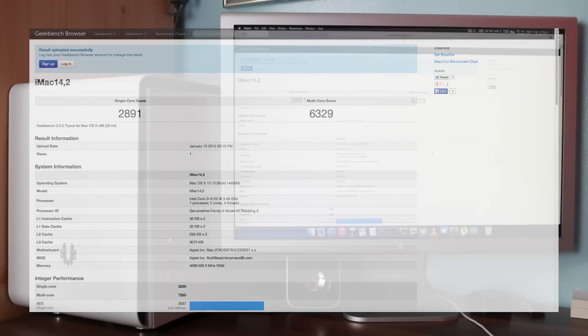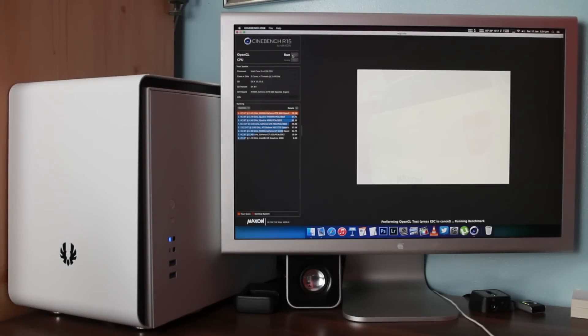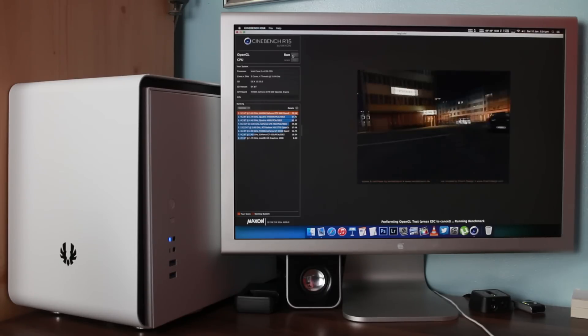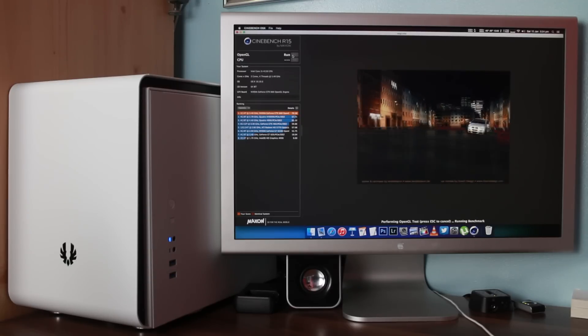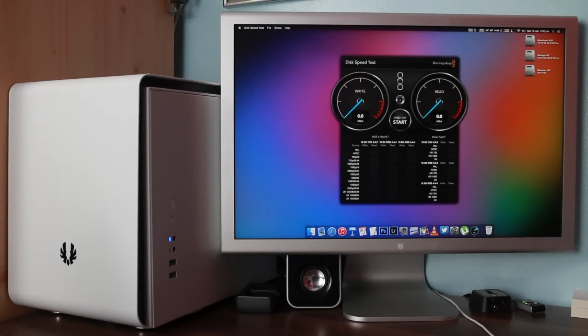It's definitely a massive upgrade over the Mac Pro. On the GPU side of things I used Cinebench R15. People have been saying the 660 is old, but it is still a monster of a card and the value for money is insane — it just squeaked under 70 FPS, which is only about 4 FPS over what a current-gen 760 gets. To test the SSD I used Blackmagic's Disk Speed Test. It pretty much maxes out the SATA 2 bus. If I were running at SATA 3 speeds I'd probably be getting about 500MB/s read and write, but for what I use this for, 250MB/s is perfectly adequate.